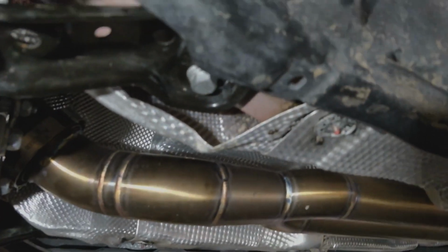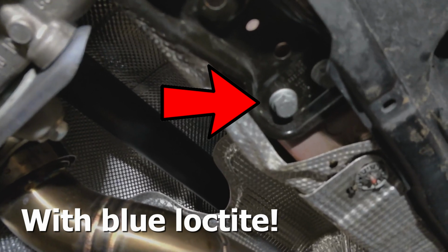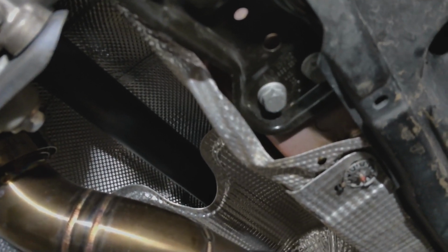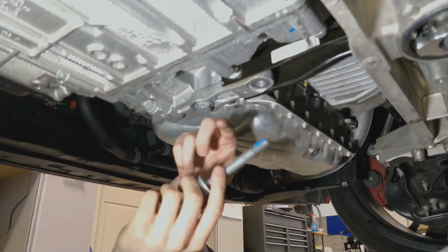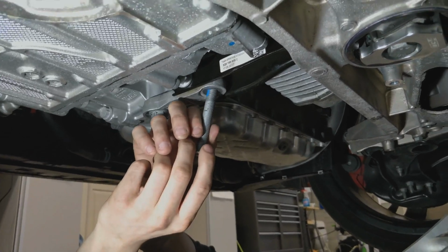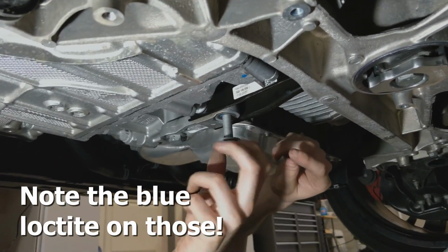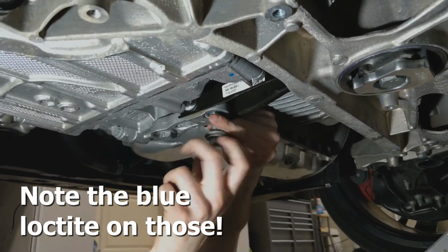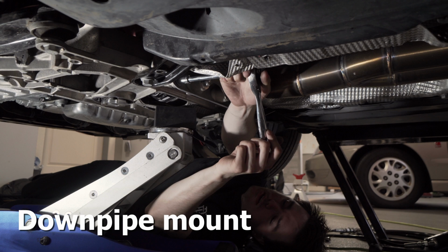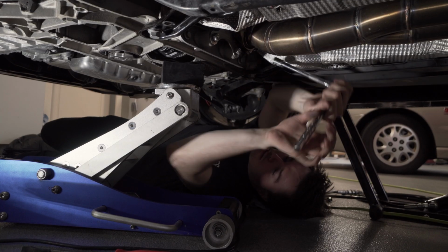The order of operations is torquing these rear brackets to, those were what, 33 foot-pounds, I believe. And then the front bracket, you also are going to want the loctite on, and those will be torqued down to 50 newton meters, which is 37 foot-pounds. So we're just tightening these 30 newton meters, 20? 20 newton meters. But we're just hand tightening it because that's probably already tighter than that.